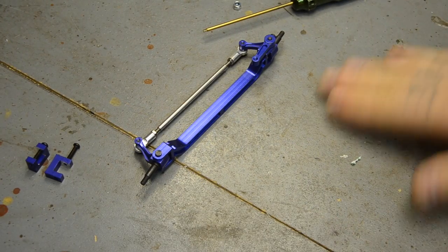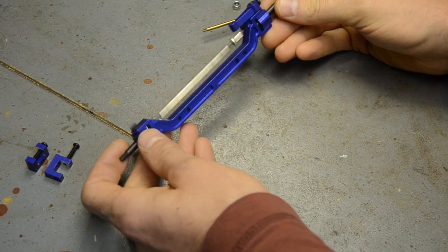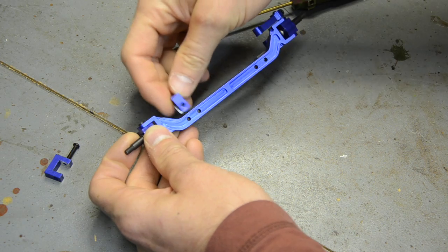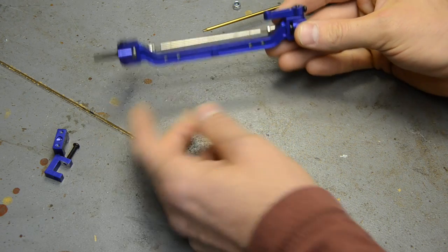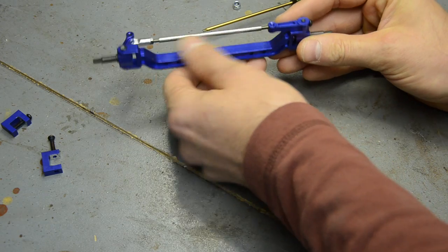Alright, so this front axle is quite a bit different than the other ones I've been using. It's not a drop axle, and the leaf perches actually remove, and they're adjustable to different widths, which is awesome, because that's going to work with the way I mount the radius arms. I can just go into the holes and leave the brackets off altogether if I don't need them.